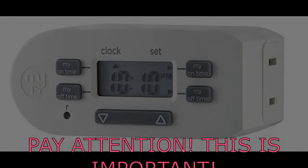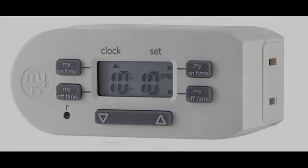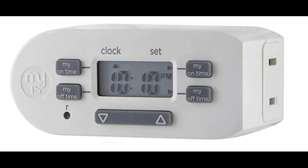This is important. If you have a light plugged in and you are within the time frame you set for it to go on and off but it does not turn on, here's the fix: push the up-arrow button and scroll the clock forward 24 hours, then go back and set the current time again. That fools the clock into cycling past your off time and then your on time, clicking the mechanism that will allow power to your device.